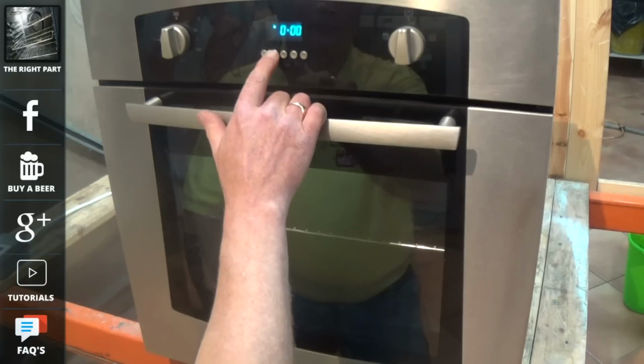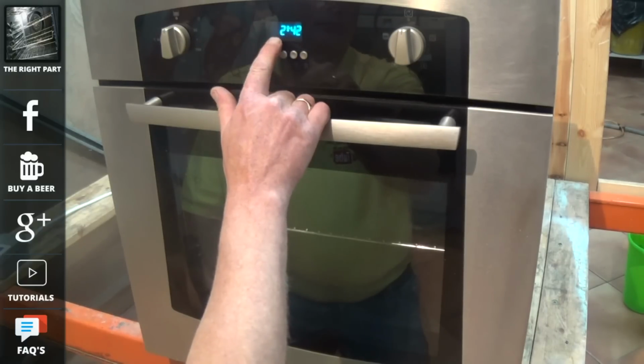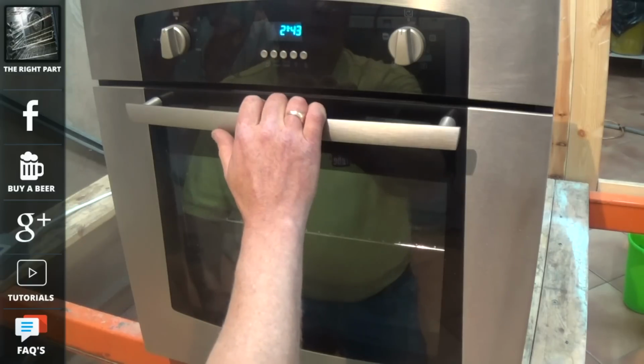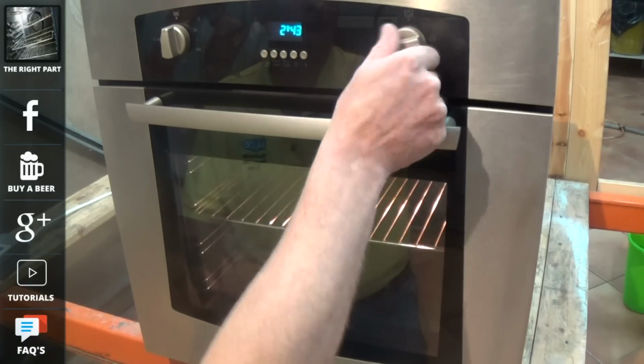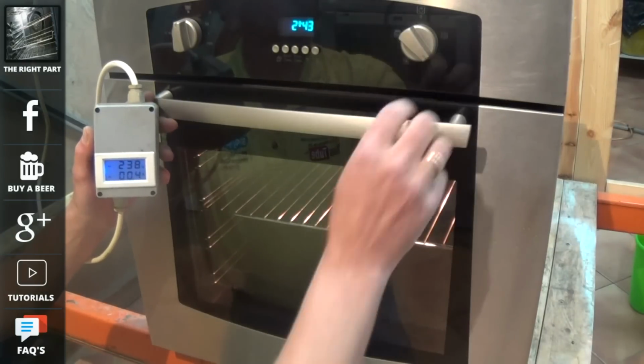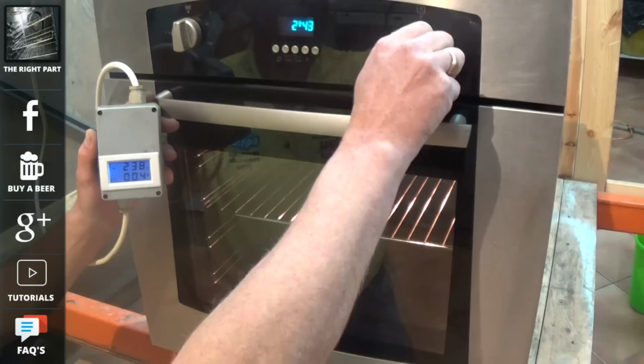If your oven is not heating, one of the most common faults is people accidentally have their timer on auto. This may have occurred from a power cut or from even cleaning the cooker and accidentally hitting the knobs. The problem with this cooker is that the main oven is not heating.